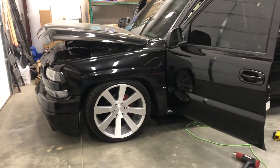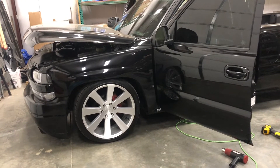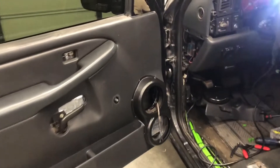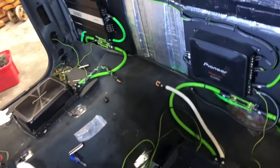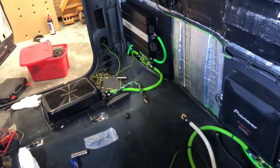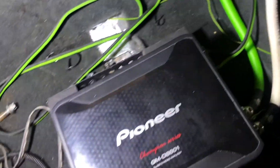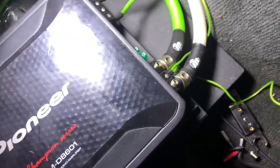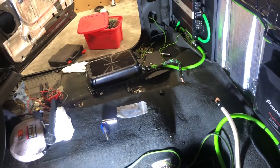What's up guys, Mario here. In today's how-to video we're gonna be talking about using a relay to amplify the current of a remote turn-on wire. Looking at my truck, I have four amplifiers. In the past I had it piggybacking a remote wire from the head unit to the amplifier and then from there piggybacking it to each amplifier, which would cause a remote turn-off pop or turn-on pop.